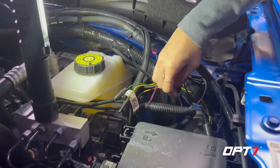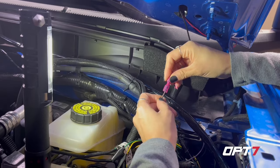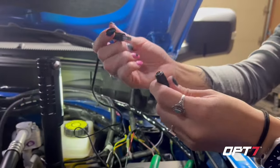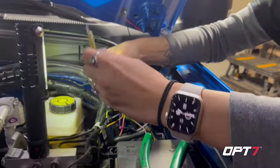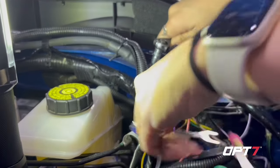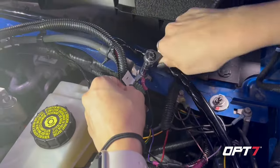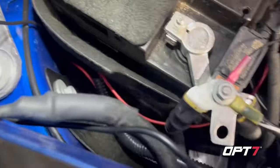We found the brown wire belonging to aux switch four. We're connecting a female lead to it, crimping it on and heat shrinking it down. Then plugging in the power for the module, and connecting the male end on the module to the female lead on the aux switch wire. There's a ground right there by the wire bundle, so we loosen the bolt and slide the control module ground underneath, tucking away the cables as best we can.